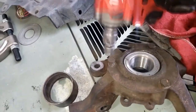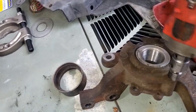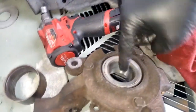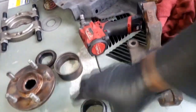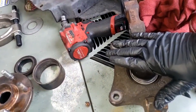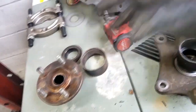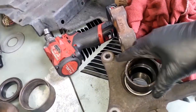The most important thing about installing the hub: you want to make sure the bearing doesn't split while you're installing it. Let's talk real quick — in order to prevent this bearing from splitting, see there are two pieces. The bottom tends to split just like this came off. If you're pressing this in with nothing under it holding it, it will do that. To counter that, I have a tool to set under the bottom so it will not split — it's going to be sitting on the surface as you press down on the hub. This is very important, or you will split the bearing in half.